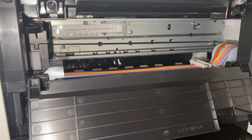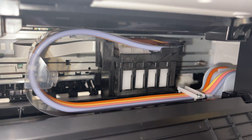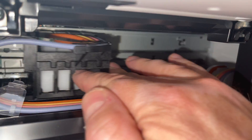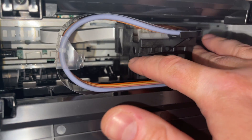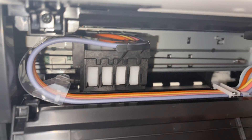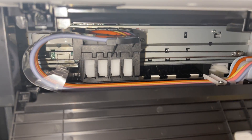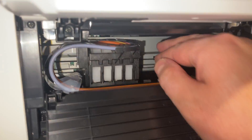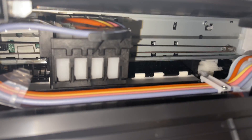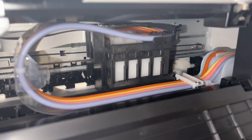As you can see, the print head is moving over. If you unplug the printer while it is printing, it lets you have access to the print head. This carriage carries the print head and there is a little play in it — in other printers it's a lot easier, but this one doesn't have a lot of working area. If you took a damp paper towel — it doesn't have to be sopping — you just put it down there so that as you slide the carriage over, the print head sits on the paper towel.